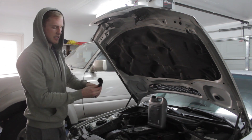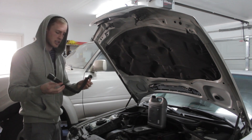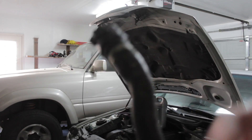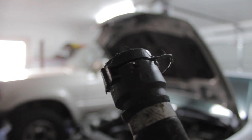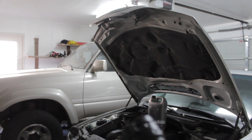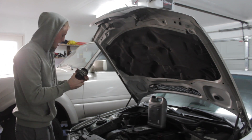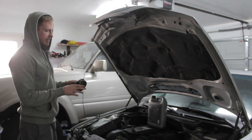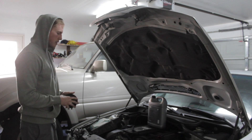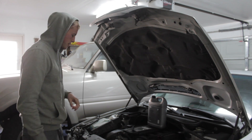The hose connections are really easy to reconnect — they just go in and snap on with a little clip. Here's another problem area: this hose was getting power steering fluid dripped on it, so as you can see it's ballooning out at the connection. I replaced that before it became a problem. The water pump has a bunch of shaft play in it, and also the stock water pump pulley is made out of plastic, so I replaced it with a metal one.